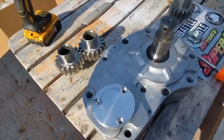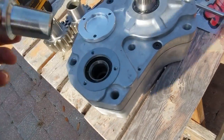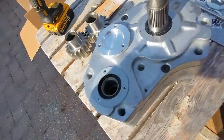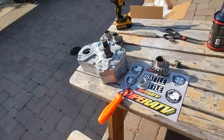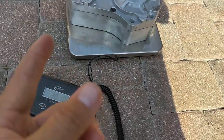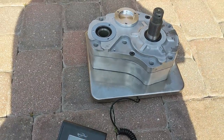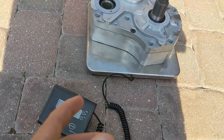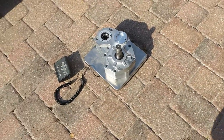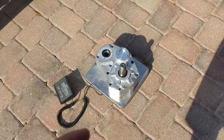I've reassembled the portal with the P500 gear — everything went in fine and the nut tightens down flush. Confirmed that the Pioneer 1000 nuts will not work with P500 top gears; it just doesn't sit down far enough and the cover hits the nut. So I've got to order those nuts and get the two correct gears. The Super ATV Gen 3 6-inch portal weighs 30.1 pounds on the scale — without gear oil, brake rotor, hub, or backplates. Usually portals add about 50 pounds per wheel of unsprung weight, which affects handling significantly and puts a lot of pressure on your ball joints. Internal gear reductions, by contrast, don't add any weight.